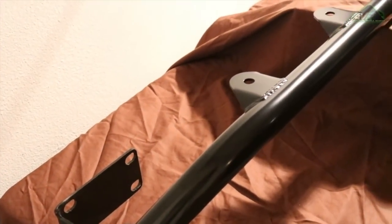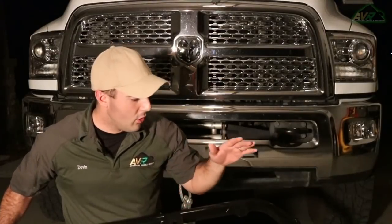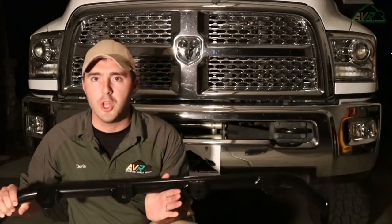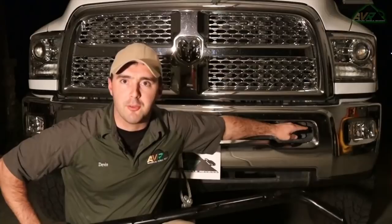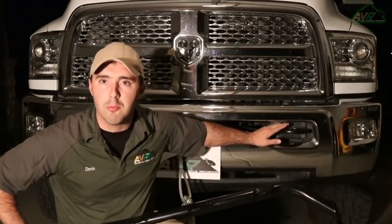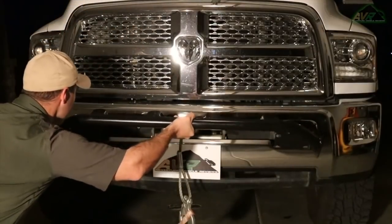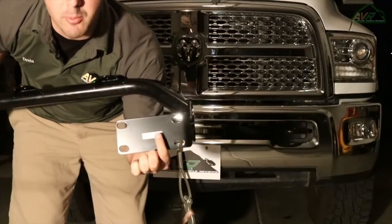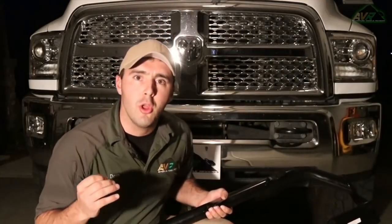This particular bar is satin black powder coated; however, it's also available in candy chrome powder coat. Just a brief explanation of how this thing goes on — once you get it, it's got these four holes which allow you to install four different attachments or one giant light bar. Additionally, the tow hooks from the factory have four bolts. After removing these four bolts, you simply take the bull bar and it installs directly into these openings with those four holes. The four holes line up with the plates on each side, and all the hardware is included with the packaging.